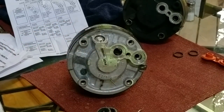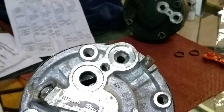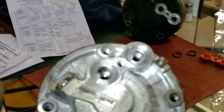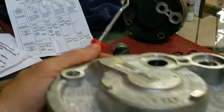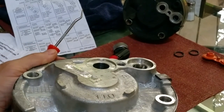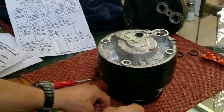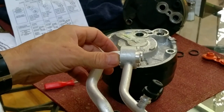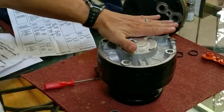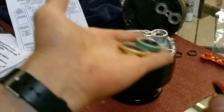With the step design, you're definitely going to have to deal with different thicknesses. If you look at it at an angle, you've got a deeper side on the right and a shallower side on the left. Ultimately, you want the block of your suction and discharge hose to sit nice and flat across here once it's all assembled, otherwise you risk a leak. That's why you're given these different thickness washers.